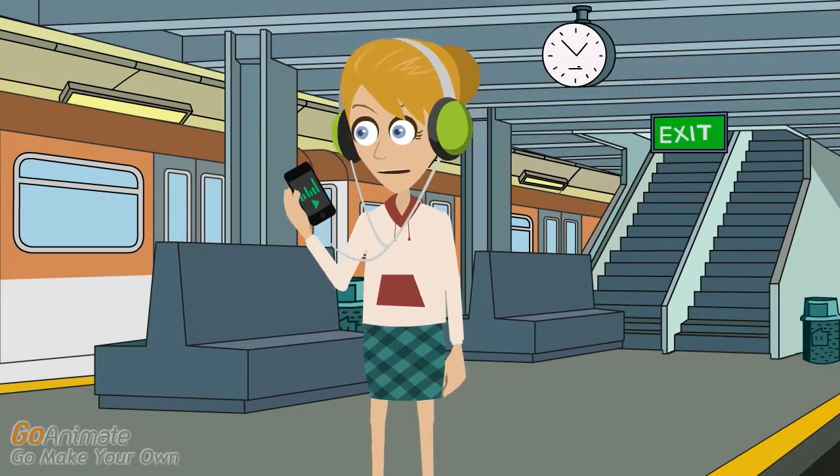Simply press and hold the Select and Menu button simultaneously for about 10 seconds. The Apple logo should appear, and then you'll know all is well, or should be. If you're still experiencing problems, then you'll want to restore your iPod.